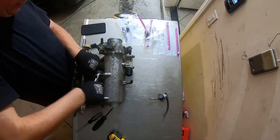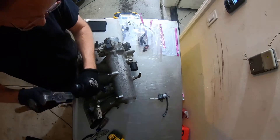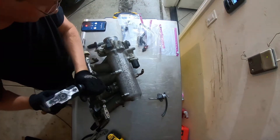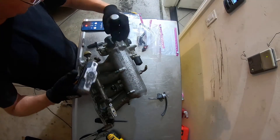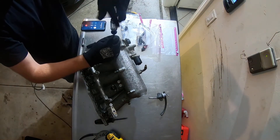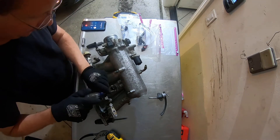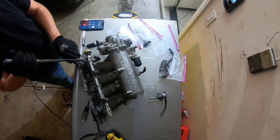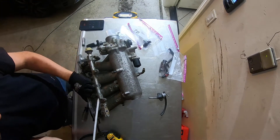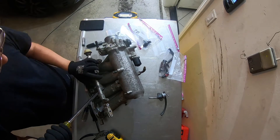Media blasted — or actually vapor blasted — the intake and the engine. The throttle body went in as well. The IACV did not. That's the only piece of aluminum that's kind of original to the car. Didn't feel real secure media blasting or getting the sand and water in it because of the electronics specifically. So it's kind of the only thing that didn't get the vapor blasting process done.